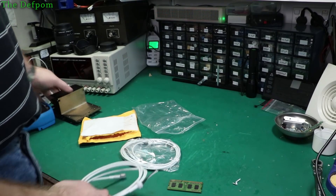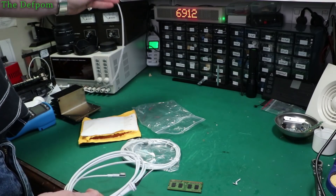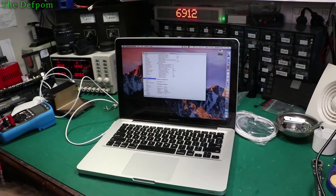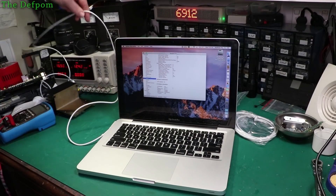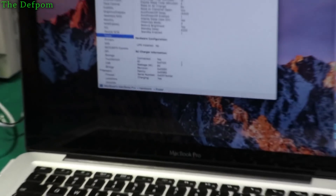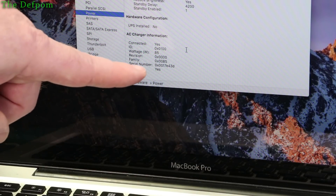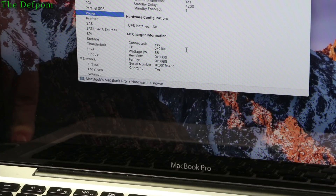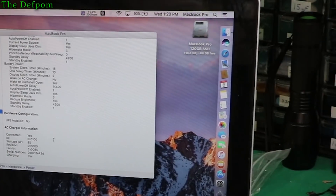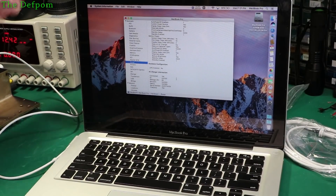The one I put previously on my power supply over there was supposed to be an 85 watt, but I think it was only a 60. So I'm hoping this new one registers as 85 watt. I've hooked this up to one of the MacBooks I've repaired — it's still working. In the system info box it reports the cable as 85 watt, so that's fine. It is actually charging too, you can see the charging icon. So the cable is doing its job. All I'm actually doing is manipulating the voltage to set the MacBook — 18.5 volts for a 15 or 17 inch, and 16.5 volts for a 13 inch.